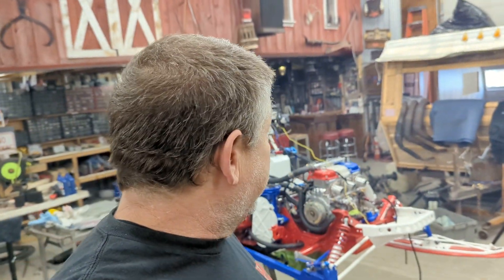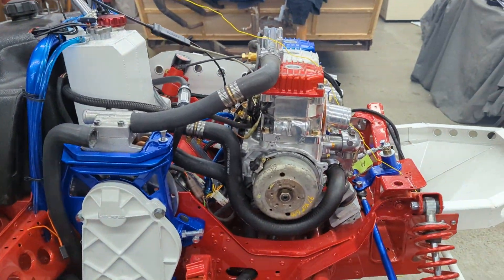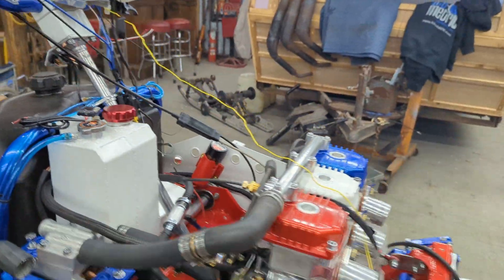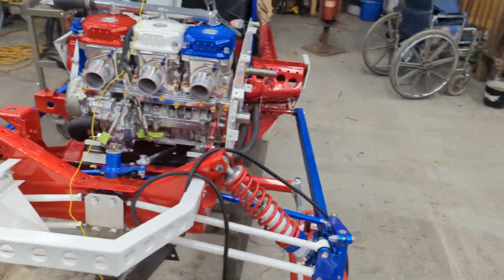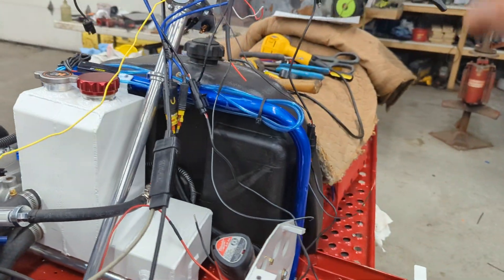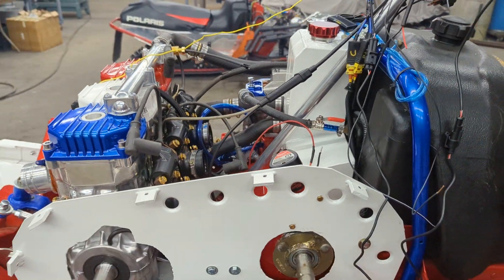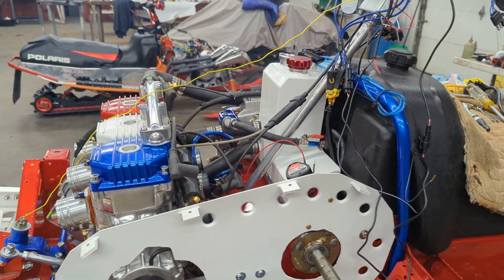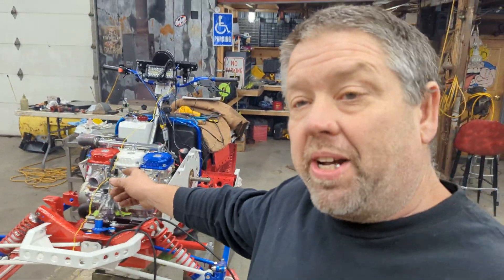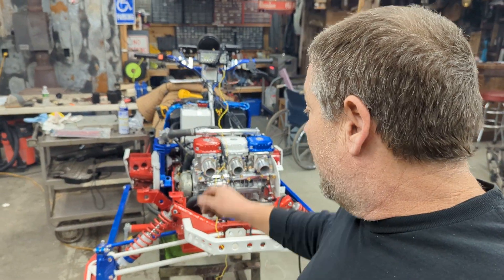Today should be very productive. All the coolant lines are plumbed in now, fuel lines are all plumbed in, and a lot of the wiring is already addressed. I've got my battery pack installed and an idea of where to run my wires. I just filled the chain case — I'd left the dipstick out on purpose so I'd remember to add fluid, so that's done now.